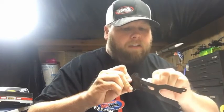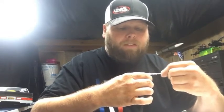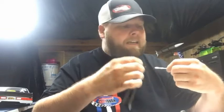Couple generations old. But anyways, yeah, you just continue to go around that, and you're just sealing the carbon fiber off. It will help amazingly if you hit something with the corner of the carbon fiber. It actually holds it together, keeps it from splintering. I mean, you're reinforcing it just like how you see some people toenail nails or screws in at an angle on a piece of wood.